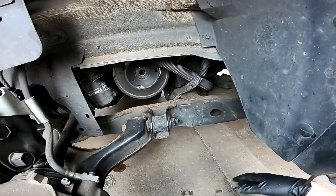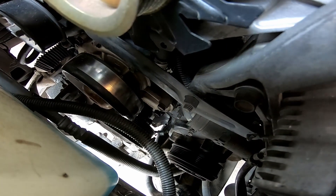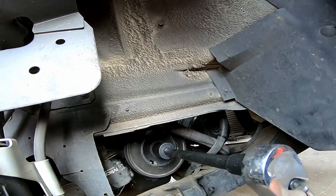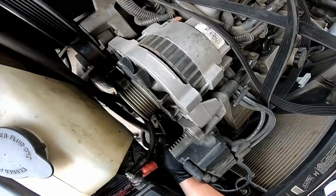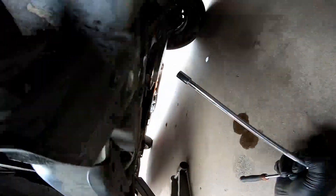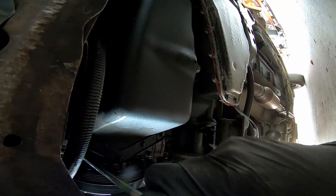I'm going to go up top and check it. It's down there on the crank and I've got a pretty decent gap on the outside. I'm going to put the feeler gauge in between and push it in toward the crank. I need to rotate it a little bit because there's a gap by the sensor — I need to get it to where there's part of the metal next to the sensor so I have something to put the feeler gauge in between. I'll do that with the one and one-eighth socket and a ratchet. Now I've got the feeler gauge in between — I'm just going to reach in and push it toward the crank. Now that it's tight, I'm going to snug up that 8mm clamping bolt — tighten it very, very lightly.